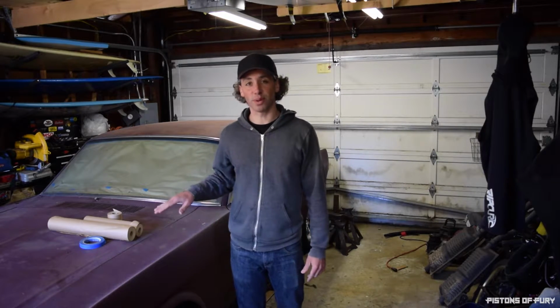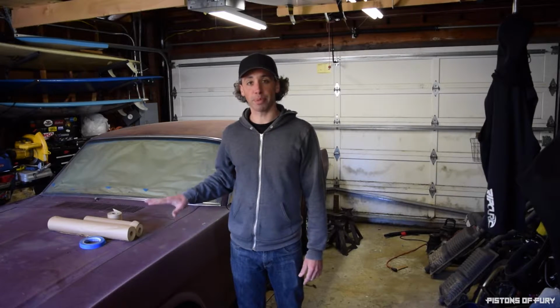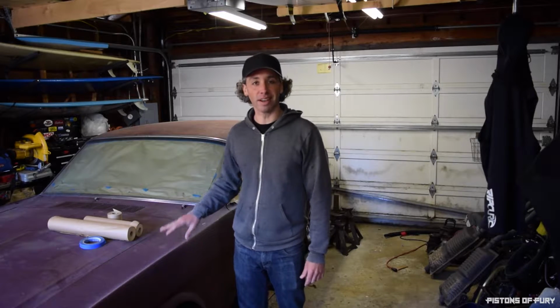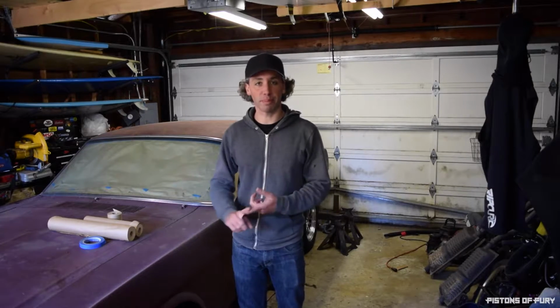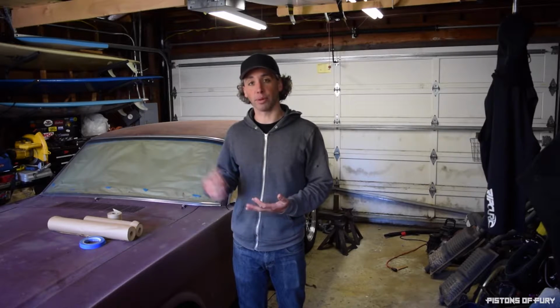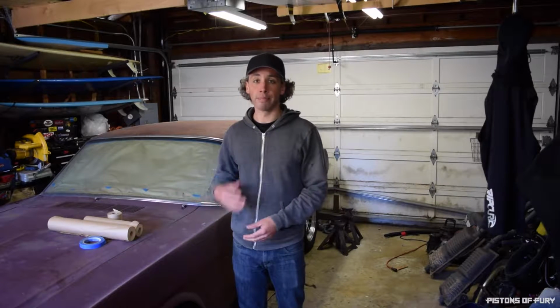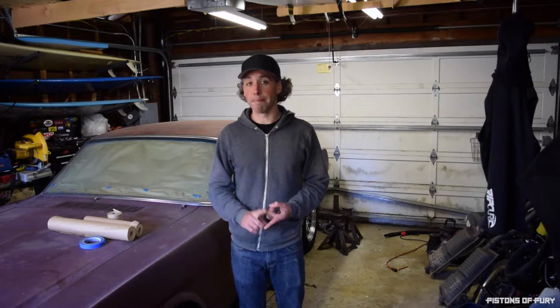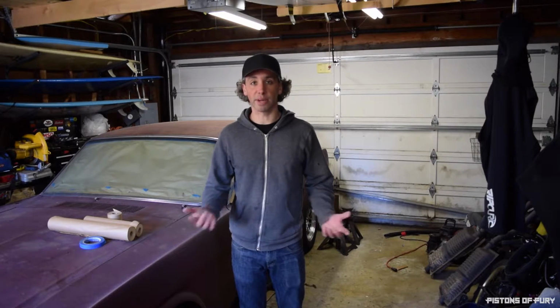In this episode, we are going to go back over the inside interior paintwork that I did inside the Mustang. I already had that sanded down. We're going to reprep, we're going to remask some areas, and then we're going to shoot some 2K primer. My goal in this episode is to get that primer done, get a few layers on there, get the dash set, make sure the paint's adhering okay, make sure all that's good. If I can squeeze it in, I may do some interior black. We'll see how it goes. But yeah, let's get started.